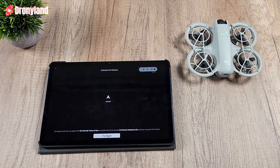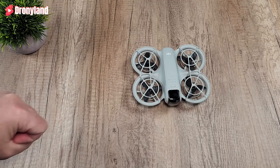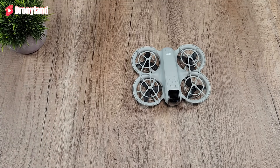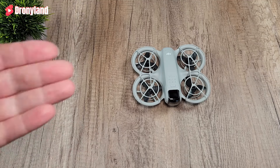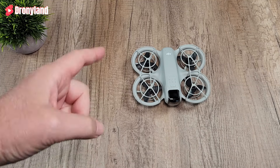Some people will say to plug it into DJI Assistant 2 on the computer, but it's not working either. You can only upgrade the firmware that way. Otherwise, for the drone itself — what they never tell you — it's that you need a data connection, cell phone data, and Wi-Fi to activate your drone. Because I don't have any cell data on the tablet, only Wi-Fi, every time it connects to the drone I lose my internet connection, so I cannot activate the drone while being connected to the drone.